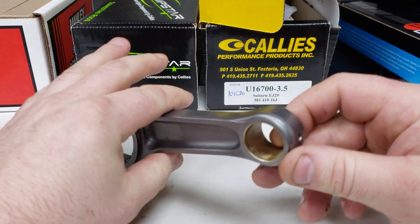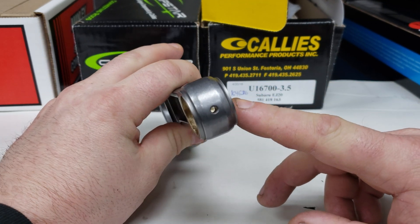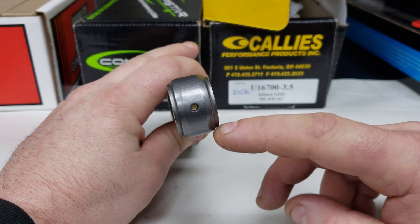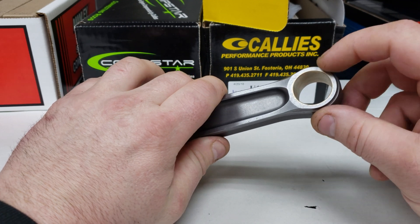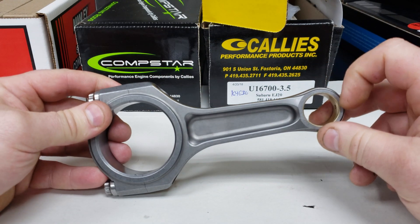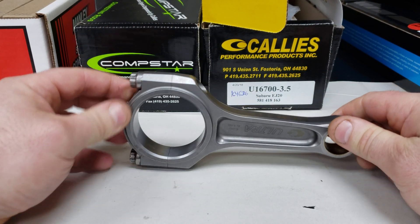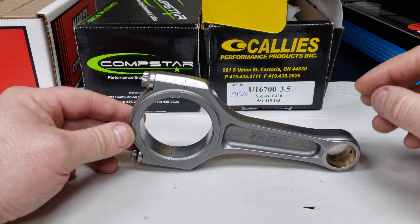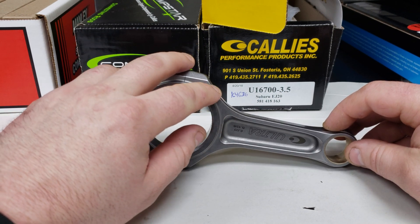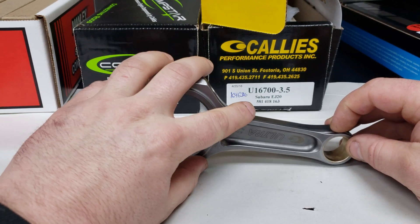The pin end is the lightest reciprocating weight of any of the rods tested here. You can see there's a lot of work to profile the end of the rod — it's rounded, and it has this back cut on the pin end. The bushing is relatively thin in this rod so they can keep quite a bit of solid material there. We don't seem to have too many problems with the bushings, it's always some issue down in the lower area of the rod. This rod is 581 grams — it is the heaviest rod out of the bunch. But you can see areas where they added a lot of material, and they did take it off of the pin end to put it in down here, which is nice.